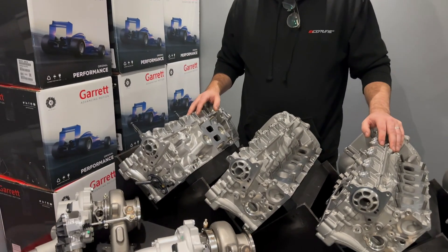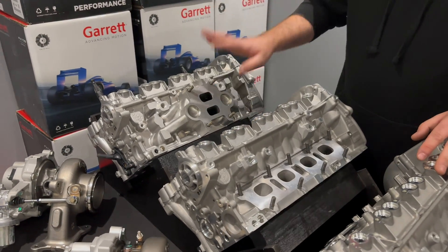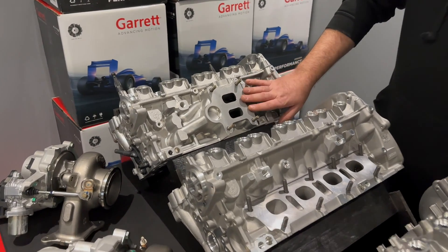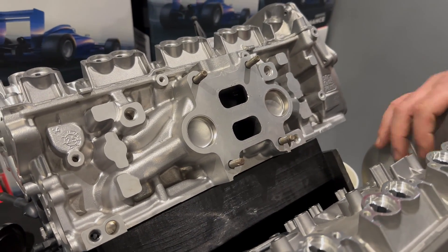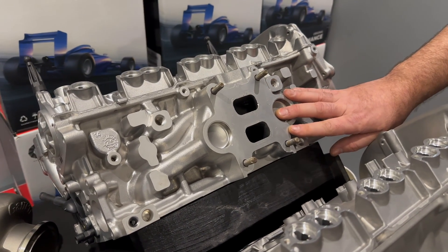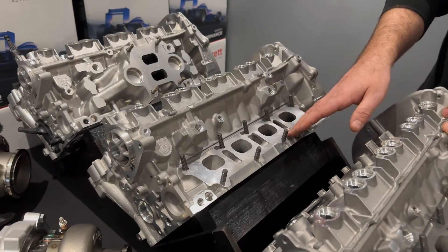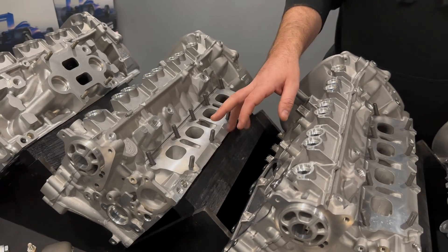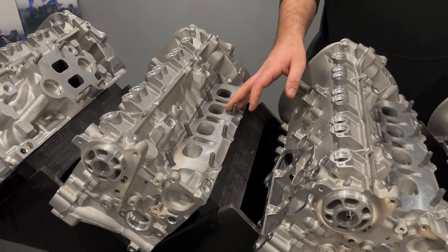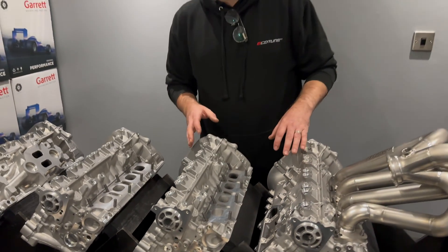The product is a cylinder head and turbocharger package, and the reason that we put this together is mainly down to the design of the original cylinder head. If you have a little bit of a look here, you can see that it's got a two-port outlet, and the cross-sectional volume out of there is small by comparison to our replacement. The replacement has a traditional four-port cylinder head, which provides you with improved knock control, reduced exhaust manifold pressure, reduced exhaust gas temperature, more power, and my favourite feature of all is a much improved sound from the engine.